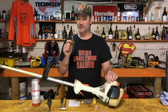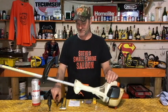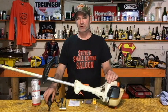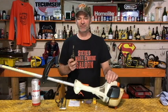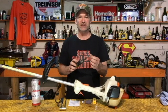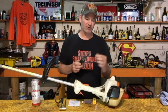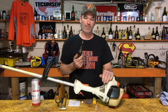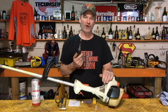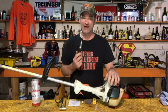Needle nose pliers, if you have some. It's going to help in at least 2 different cases here. Get the carburetor off. Here's your biggest challenge right here. You have to have either a 5/16 or an 8 millimeter socket to get those 2 nuts off to get your carburetor off. Has to be a 1/4 inch drive. It has to be a small socket to get in there to get those nuts off.